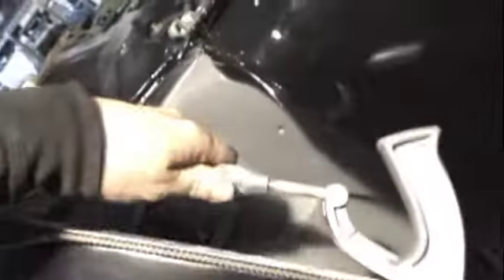We've went through welding up a couple spots on the door and getting the door edge dollied, trying to get it to fit better. It had some angles and different pitches to it, so I've went up and down it with a nice metal rasp and shaped it all to fit. Now we're sitting right where we need to be. This was went out to a point and had a dip here, had a blemish right in here, and a roll in here — up here was pretty decent on this side. This side matched up to the file that we matched up here — we took a file off of here and went around.